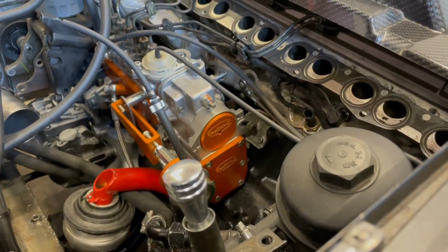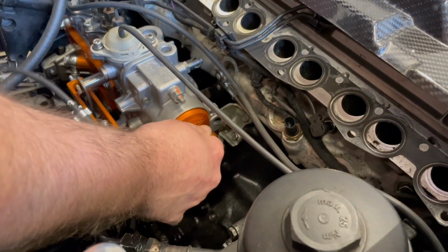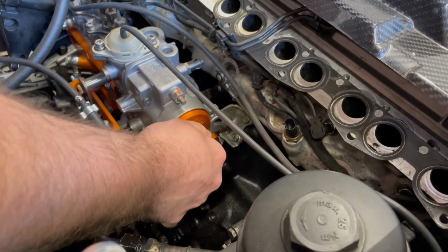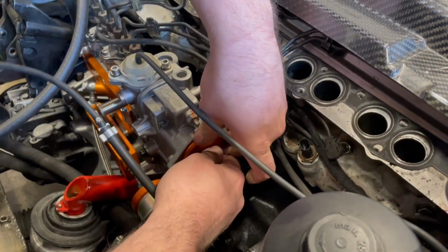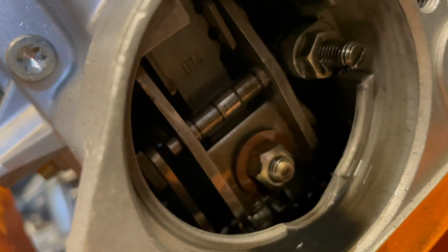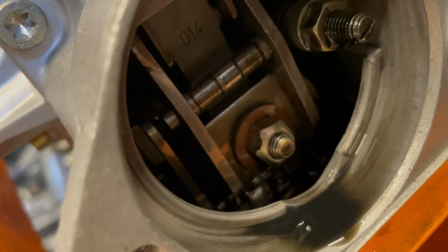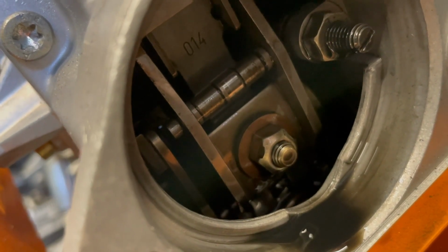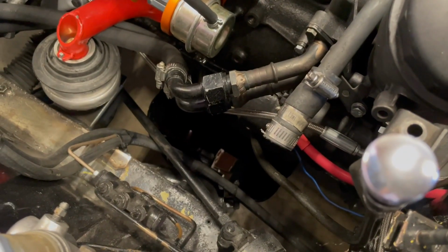Okay, underneath this is the governor. This is where the solenoid used to go, and now is just a cover, allegedly. Very difficult to remove cover. Oh, there it is. Let's take a gander in there. Whoa, look at that. All right, so the nut there, we're gonna want to tighten that apparently until the idle audibly increases. And then we're gonna use this idle adjustment screw to bring it back down. Seems simple enough.